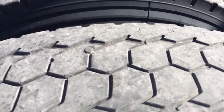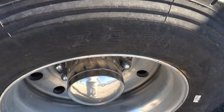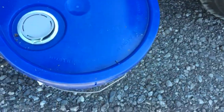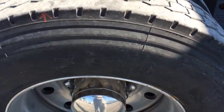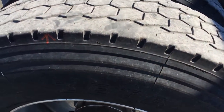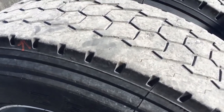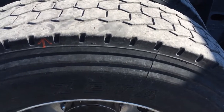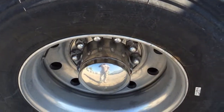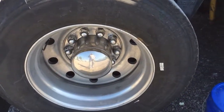When the guy took the tire off the rim, let me tell you how this stuff works. Here it is — I still have some left. It's a gel that goes into the tire and has these fibers. When there's a puncture, you're losing pressure from a point in the tire — the fibers collect around that point because they're trying to escape, and then the gel seals it up. When the guy took the tire off, there were fibers all around the rim that were sealing the leak.